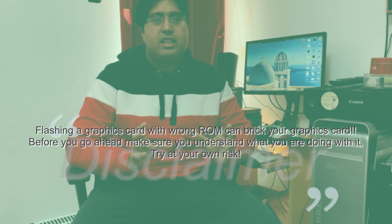Having said that, you need your old graphics card. I had the ATI one and with the help of that I was able to install Windows on my Mac 5.1, and that's the graphics card I basically chose. It was a Sapphire HD 7950 — a boost graphics card. The ROM that I'm going to put in my description will work with this one for sure, because I've been testing it.